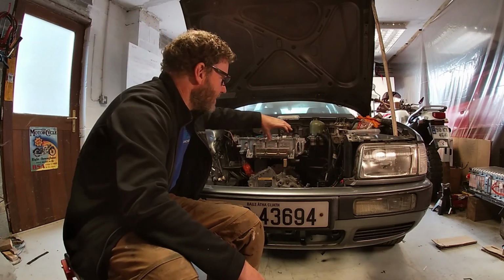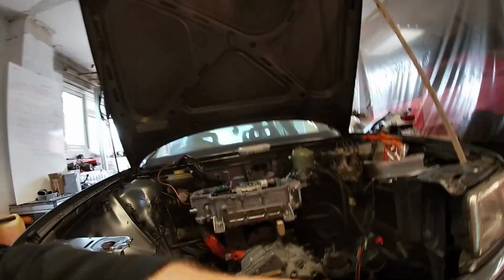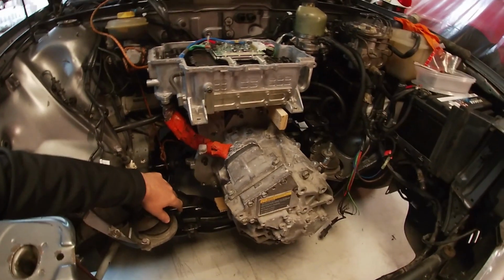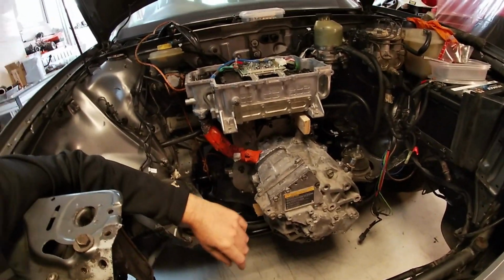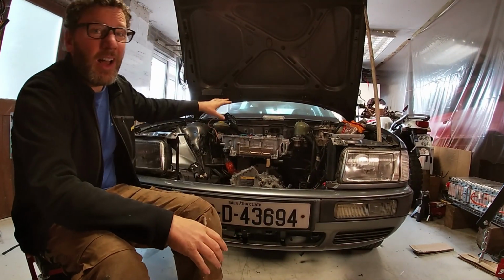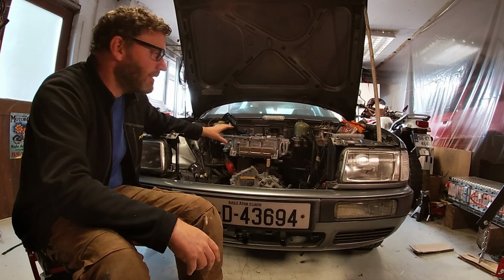Originally I was going to have it sitting longitudinally so I could put the high voltage junction box alongside, but what I've done here, I'll show you, is reuse the Nissan Leaf 3-phase cable from motor to inverter. That saves a whole lot of hassle because you've got your terminals already in there, they're all rated, very overrated for what we need, and they're shielded and all that type of stuff. So that's kind of what I'm looking for, to reuse as much out of the Leaf as possible. That's probably where it'll sit.